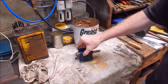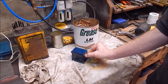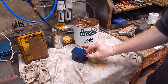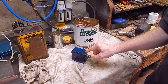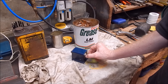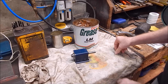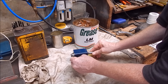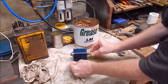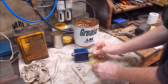Grease up the bearings and races, then slide the spindle back in from the chuck end. Then put in the ball center at the other end — make sure you put it in the right way, because one side will be slightly thicker than the other. The thickest edge faces out. When you disassemble, note all this, as they're generally slightly thicker on the side you're preloading against. Don't punch on the centers; just use the nut — there's enough thread to do it that way. Hold the spindle with a drill.